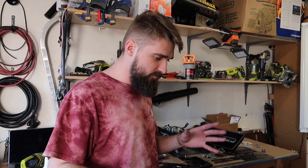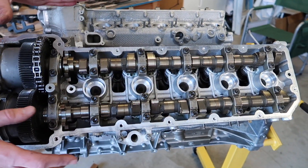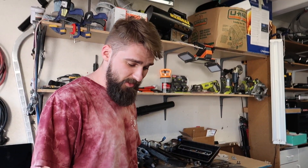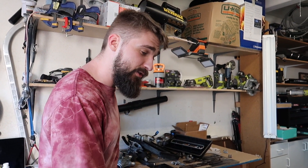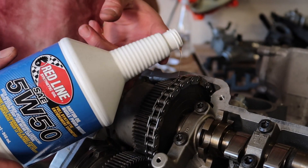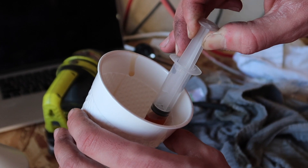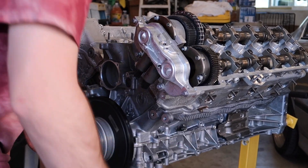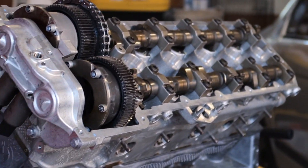Once everything is working out, just double check everything, oil everything up — all the cams, all the gears, all the chains, lube them up a little bit. Then spin it as many times as you want just to double check that your timing is actually good. Keep using those timing tools to double check everything. That's pretty much it — that's how you set timing on these V10s. It's not too complicated but it's pretty tight. Make sure to like and subscribe because there's still a ton of work to do on this motor.